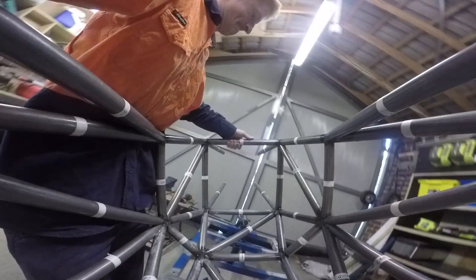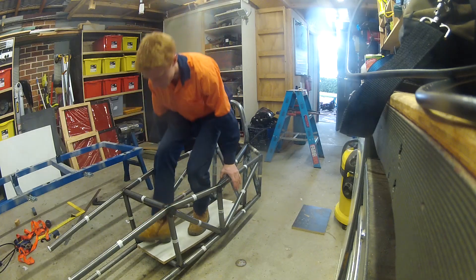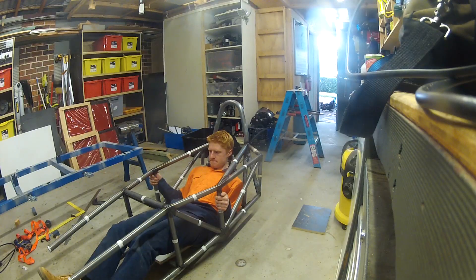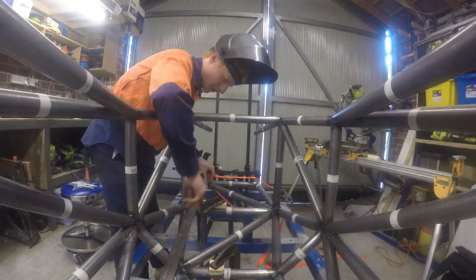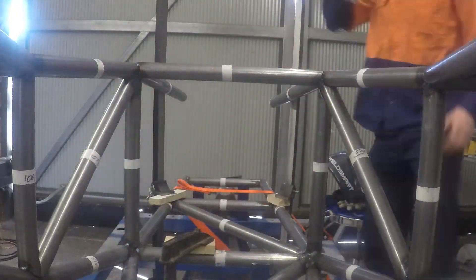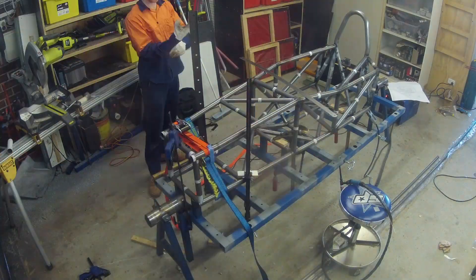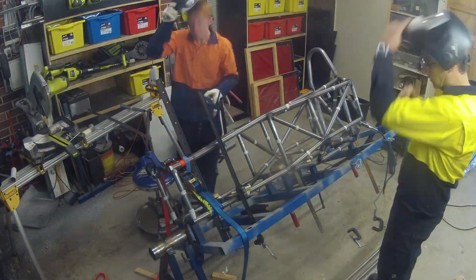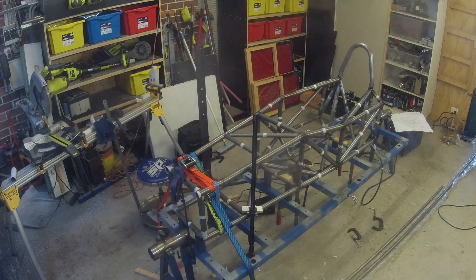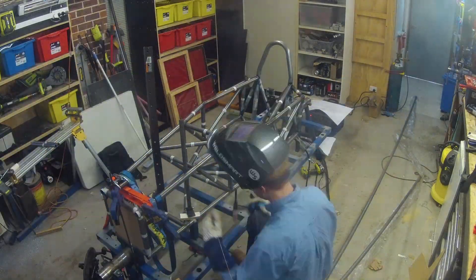The main cockpit area was now done, and I couldn't resist jumping in to see what it felt like. The front lower bracing stopped short of the pedal area — a flat plate would eventually go in at the base of the pedals, allowing me to sit my feet as low as possible without any chassis members in the way. The plate would be riveted all the way around its edge forming a stressed skin, so the stiffness of the chassis shouldn't be significantly affected. From here the bracing went in pretty quickly. I changed from one-and-a-quarter inch to one inch cross bracing, which meant that the tubes intersected a lot less, making fitting and welding so much easier.